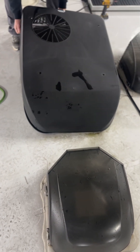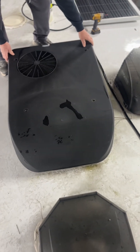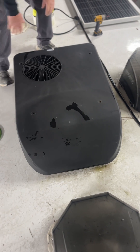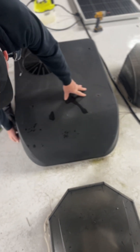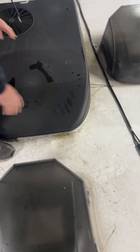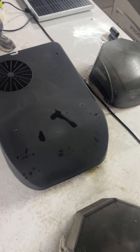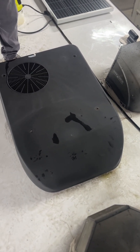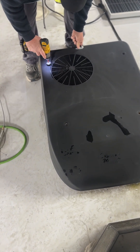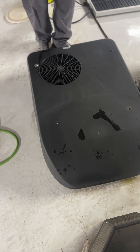Be careful when you put them on — you can slide that back on the top. You just have to work the cover around to get it back on. You want to be careful when you put it on not to damage the coils in the back. You can see you just want to line up the holes. We do a lot of these where somebody before has taken this cover off and over-tightened the bolts or stripped them out. If the bolts are stripped out, you can have a mess on your hands. So we try to make sure that we don't tighten them down too tight.